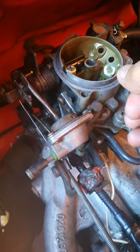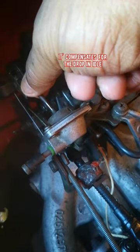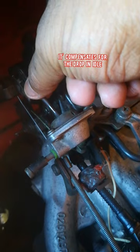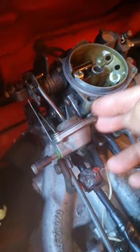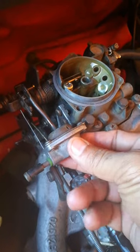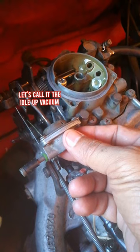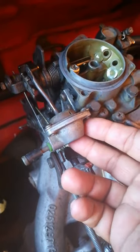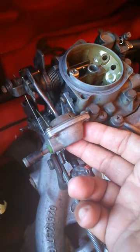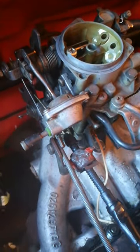As you know, normally when you have an aircon on your car and you switch it on, the idle tends to drop. So what this part does is it compensates for the drop in idle — as engine vacuum pulls on the diaphragm inside here, it will increase the idle speed. That is what this component is actually used for, so let's call it the idle up vacuum.